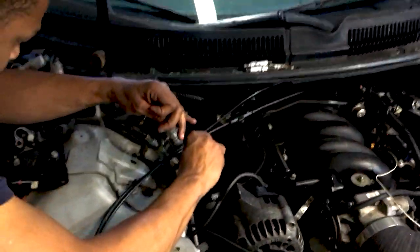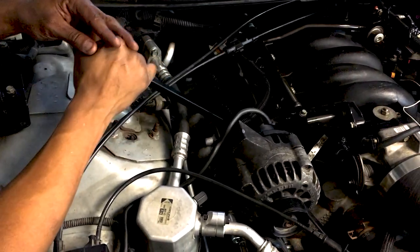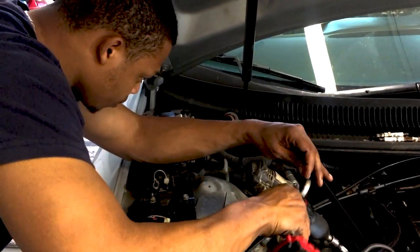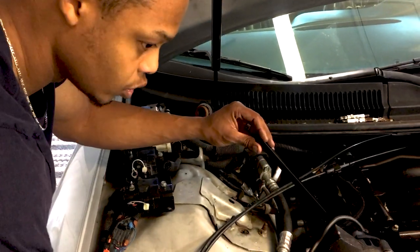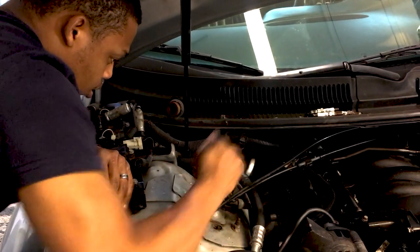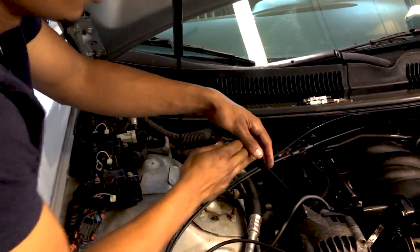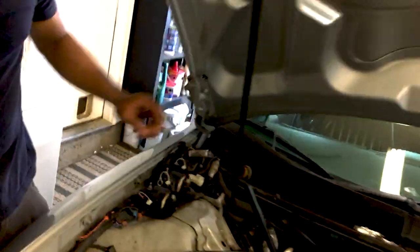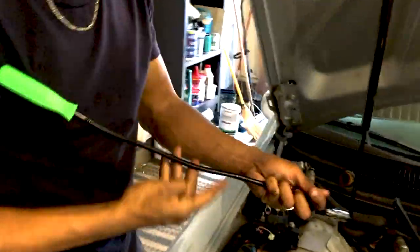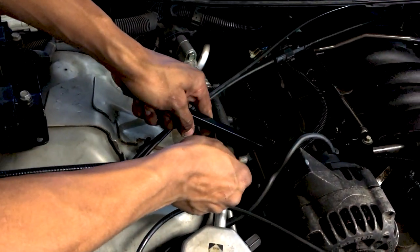Get ready. It's tall, it's high enough. You don't want to push the valve down — if you can push the rod/valve down, which is low, you don't want to. You want to try to impact it loose, like that, so it breaks free. Let me get a magnet really quick and bring a light over here.